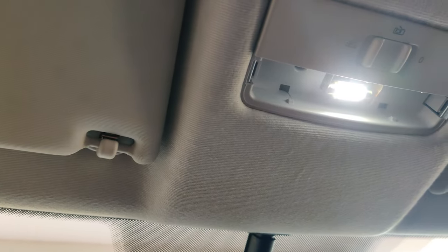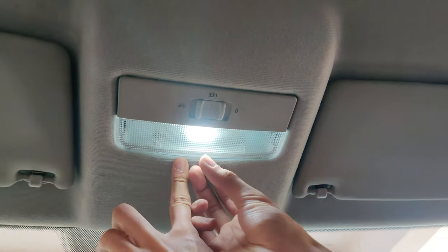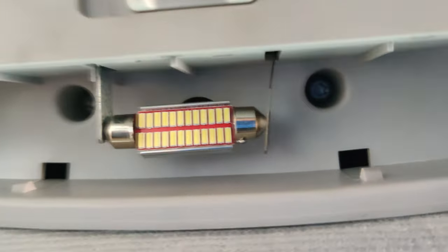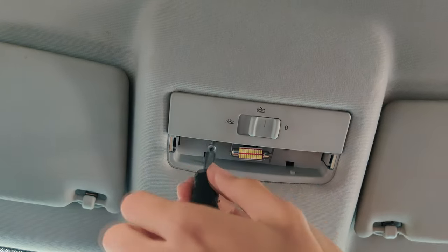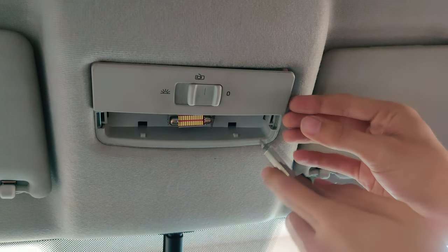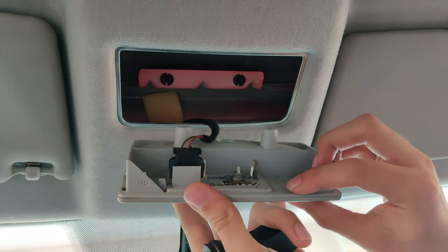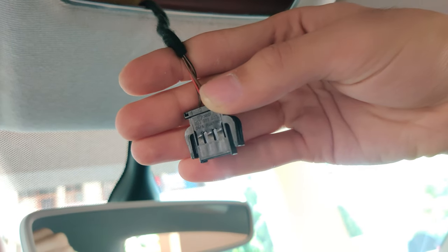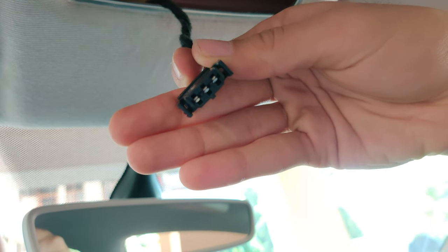To install this new light we need to remove the old one by removing the plastic lens first. Just push the headliner in slightly and pry the plastic piece out. From there you can see the two T20 screws you need to undo. With tabs on either side of the light pushed in, you will have the unit in hand, still connected to the connector and wiring harness. This is a pretty tight connector — its arms need to be pushed out to clear the tabs and using a flat head screwdriver here really helps. Use it carefully though, do not break these arms.